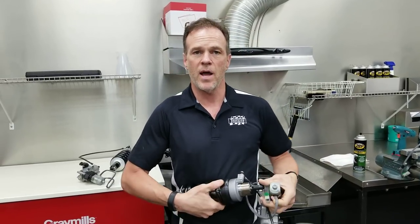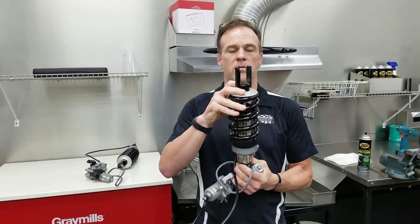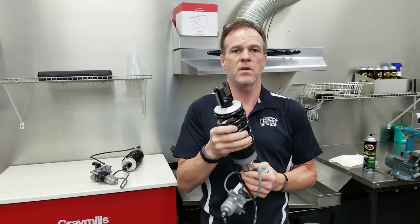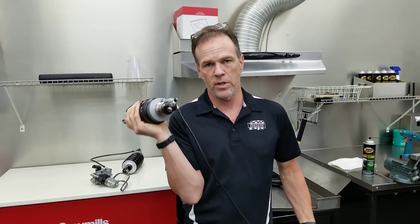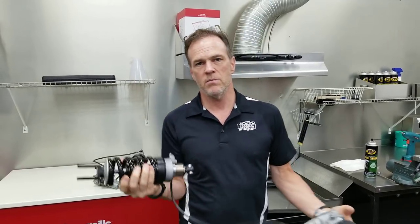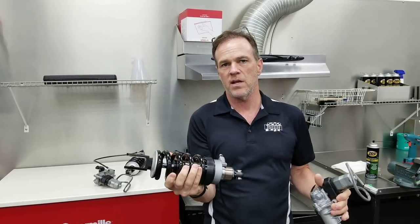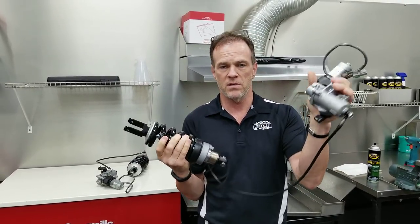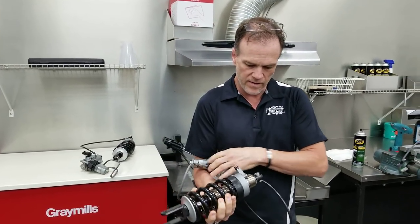The way you change ride height is not available on a Honda Goldwing. It would be to lengthen or shorten the clevis, so you're changing the eye-to-eye length of the shock without changing the preload on the spring. So there's some information. All you're doing is changing preload on the spring. No effect on damping with this system on any Honda Goldwing, new or old, okay? So now that we have that straight.